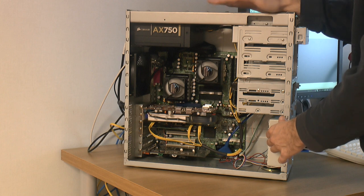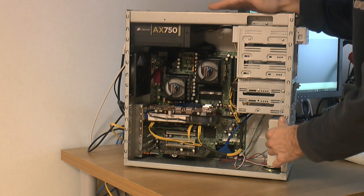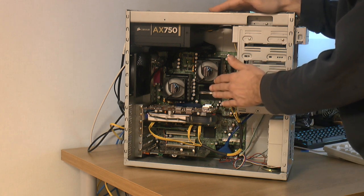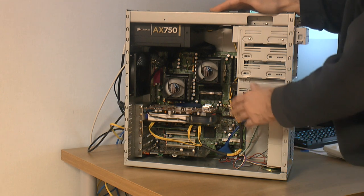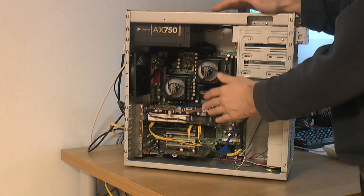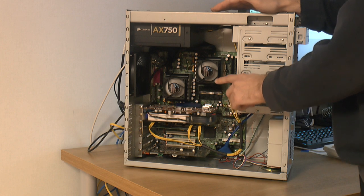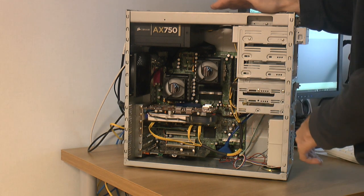I would highly recommend the 760 MPX platform as a retro platform if you can find a motherboard for a good deal. Some motherboards like the MSI version support overclocking so you can get more performance. You are limited to the 266 MHz bus, but you can mod the L5 bridge to put in Athlon XPs, and you can technically put in Athlon Thunderbirds, though the MPX platform may not support those fully.